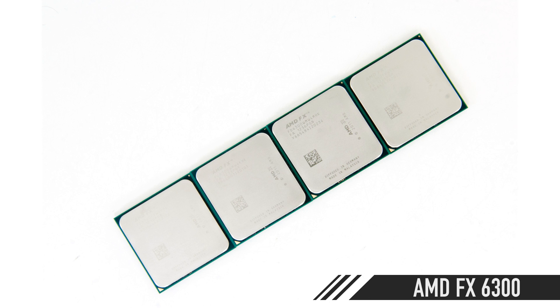For the AMD option, I'm loving the FX-6300 that just came out, and also the FX-4300 because of the price — they're just a little over $100. For just over $100, you're getting a lot of speed. When you compare it to the i5 in a lot of games, it's only about 5 to 7 frames per second slower. So for about half the price, you're getting a hell of a CPU. I like it better than the 1100T, which I recommend a lot. The FX-6300 is 3.5 GHz and a 6-core CPU; the FX-4300 is a quad-core. But if you're just gaming, either one is going to be great.